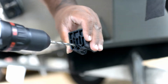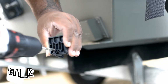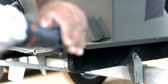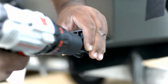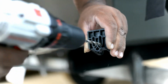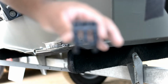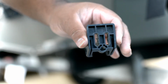That's just the start of it. I'm gonna trim it up a little bit more before I put it on there. Had to end up putting washers behind this little plastic mount here, that plate that's on the boat. By the time you put the transducer on there, it's bumping up against the stump guard. And sometimes it won't let you tilt the angle on the transducer. So I don't know if they make another mount for that or not. If they do, leave a comment and let me know, or leave me a link to where I can find me another bracket.